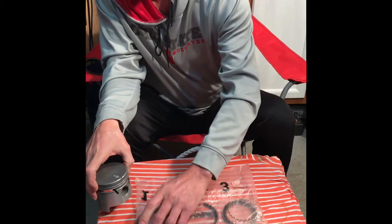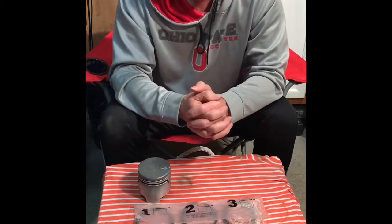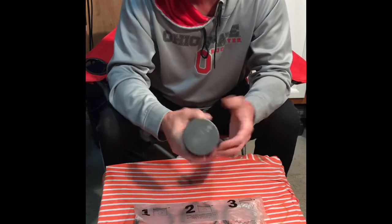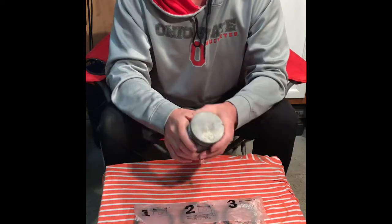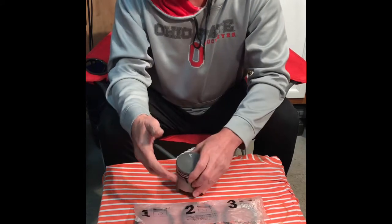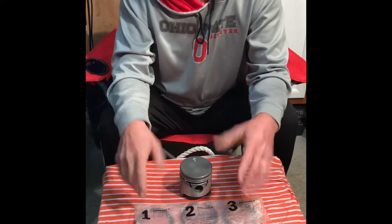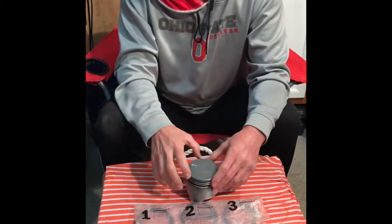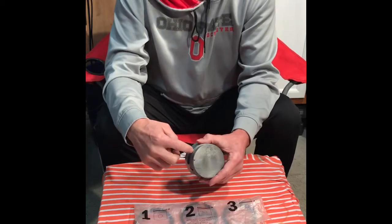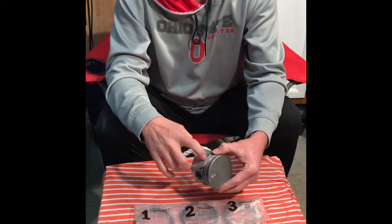The reason it's important to read the instructions is because it gives you a good idea of what you're dealing with. There are two ways you can install these rings: you can either do them with your bare hands using no tools at all, or — the better way — use a ring expander. With the ring expander pliers, you grab the two ends of the ring, expand it enough to slide it down into the piston groove, then let it free to sit in the groove.